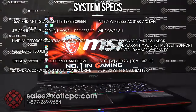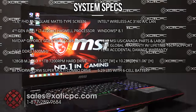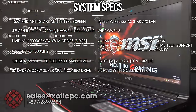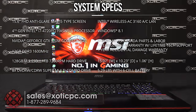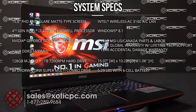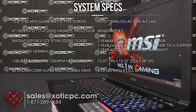For the CPU we have the Intel i7-4720HQ which works at 2.6 to 3.6 gigahertz — that is not upgradable. For the video card we're looking at the Nvidia GTX 970M, it comes with three gigabytes of GDDR5 memory, also not upgradable. For the RAM, pre-installed 12 gigs of 1600 megahertz, that is upgradable to 16 gigabytes at the max.